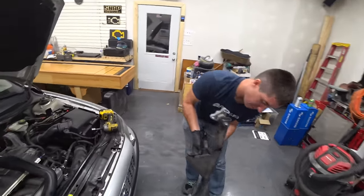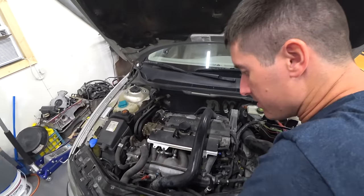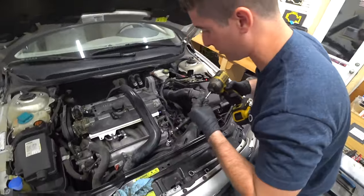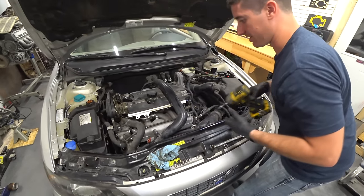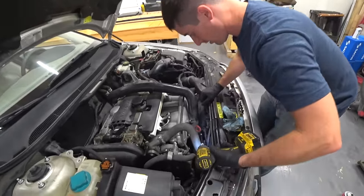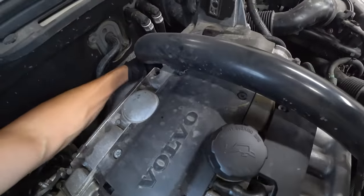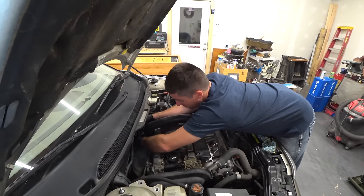I'm going to go ahead and put our bolt back on and put all the bolts back so I don't lose them. Next to come off is the Boost Bazooka. We have to get the Boost Bazooka off and there's a wire back here that's got to come out of its clamp. T25 to pull off the Boost Bazooka. Turns out it's a 7 for the worm clamp. We had to use a 3-inch extension with our 7 to get to this clamp, depending on how it's positioned.